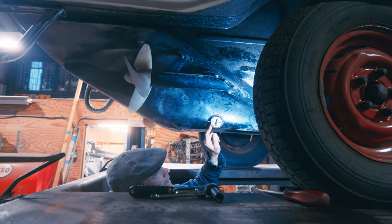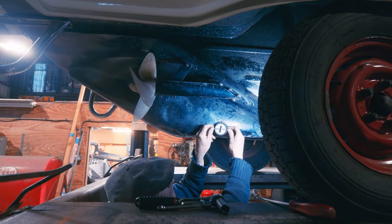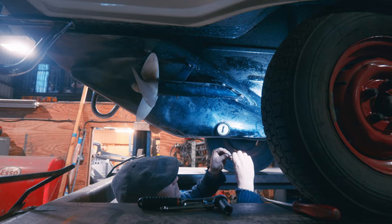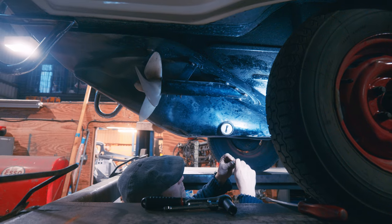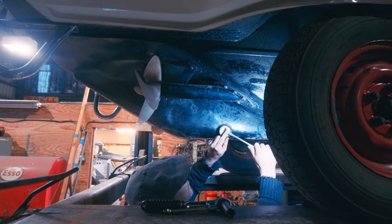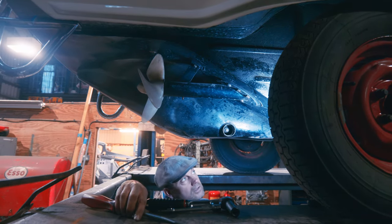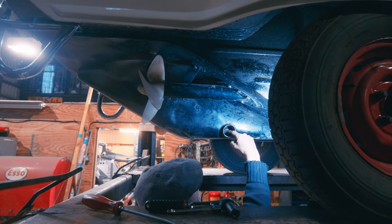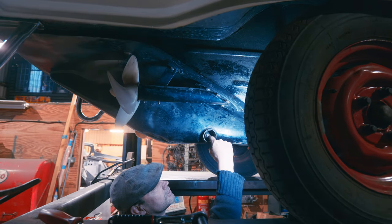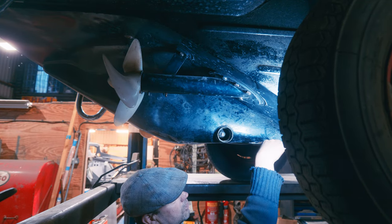Talked about the plug - that's the plug. I've just put it in just so we can see. You don't drive around with the plug in - you remove it every time you come out the water. We're going to do an oil change. You can't change the oil with that in there, because as I said it comes out through the bilge effectively. So plug it out. And then when you see in here, that's the oil drain bung. If we undo that, the oil will come out here. But it does tend to sort of sink back in here and then roll down into the bilge.